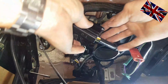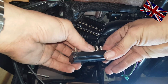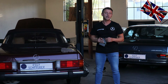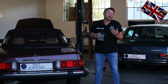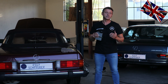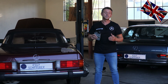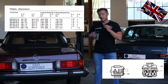There are other videos in this chapter about cruise control in which we were checking other components, such as the plug with 14 pins, which we all checked individually for connectivity. Some of the pins did not make proper contact with the socket, so we gave them a wipe with some fine sandpaper. Another step was unbolting the actuator and repositioning the actuator arm in neutral position. We have checked the length and condition of the throttle linkage to make sure it fits snugly right down to the millimeter, so it is properly engaging.